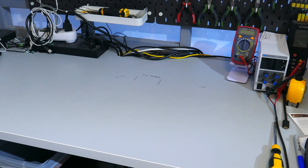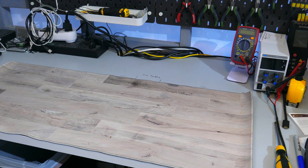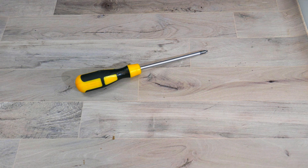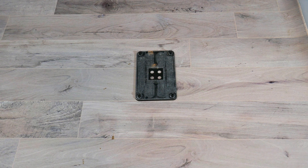The installation between Intel and AMD sockets is different, so if you're planning to install this on an Intel socket, please check the installation guide. Before you start, make sure you have a flat, clean, and sturdy surface — preferably an anti-static mat, but in a pinch you can use the box your motherboard came in. You'll also need a PH2 screwdriver, some isopropyl alcohol, and something to wipe the CPU with.